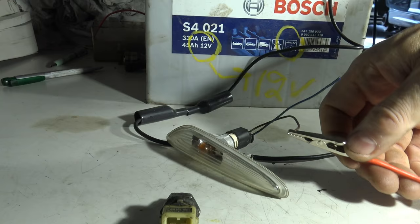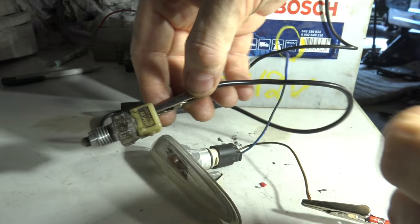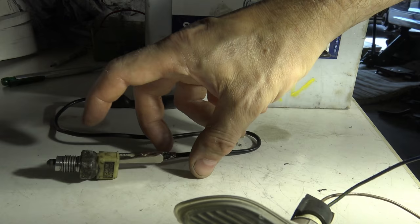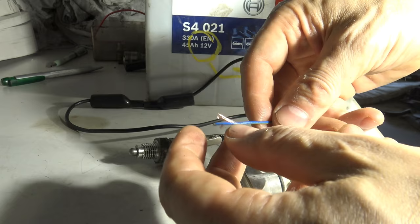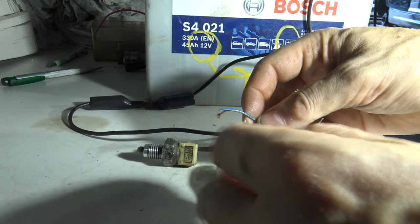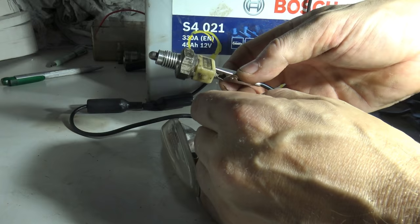When I press that it goes down - look, this is interesting. There is a switch inside that thing and two cables. To test how this works, I connect one of my minus cables here - this is normally on the minus line. Then there is the reverse light. I connect this cable to the reverse switch, and insert that into the slot to make a nice connection. Now there is no light.